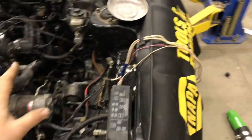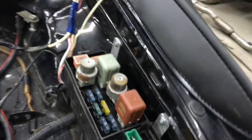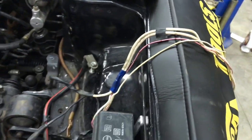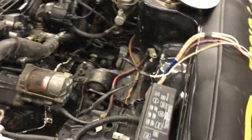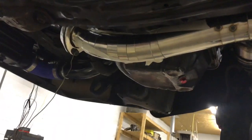Once this stuff is installed, go back to the pile of stuff and figure out the best routing one wire at a time and secure it. I've got the fender cover on here protecting the fender so as I'm routing these wires I can throw them over the fender without scratching anything. Made some mounting tabs for the fuse box — it's just mounted to the side of the inner fender well. Got these wires for the alternator and various plugs; going to route them around and under, keep them out of the way and hidden. Trying to make this thing as clean as possible.